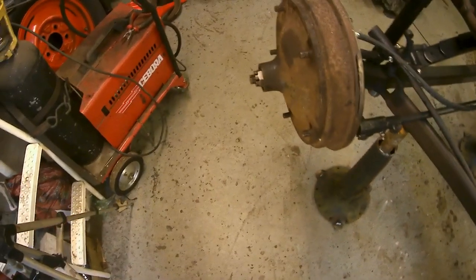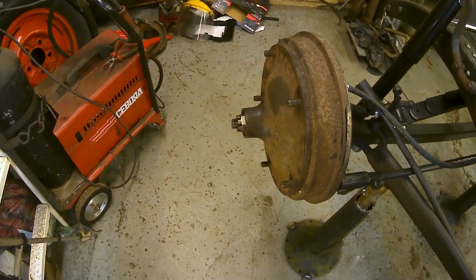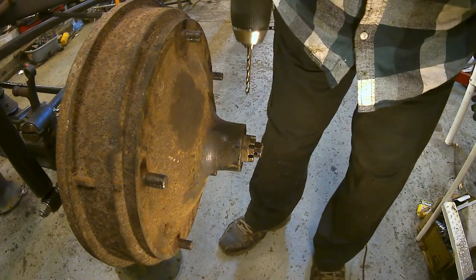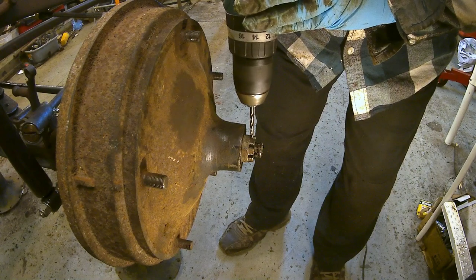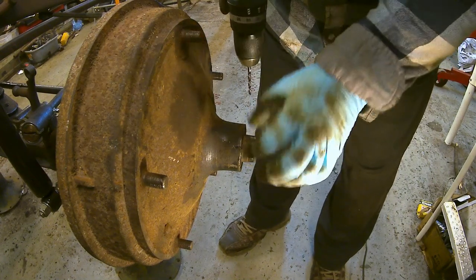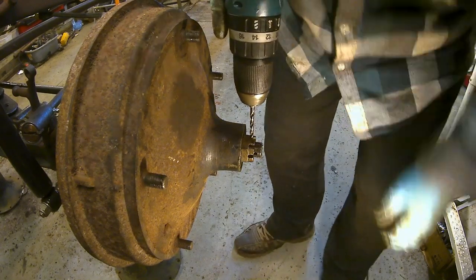Okay, anyway, that's the idea. I'll bring you back when there's more to show. I'll have a little think about how I'm going to do it. Right, I've got to drill vertical that way and slightly that way. I've put two bits of sheet metal between the washer and the bearing to just bring the thing out this way a little bit.